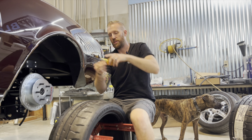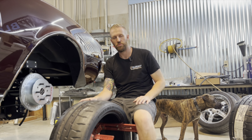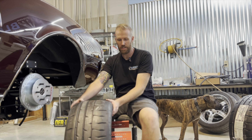Here we have Joe's 68 Firebird on the Roadster Shop spec chassis. The first thing we're going to want to do is measure the wheel well width — about 11 and a half inches — so we're going to order a tire that has a narrower section width than that. This particular car we've been running 275s for years. It's always fit really well, so we decided to go with a 275 again, except this time we're doing an 18 in the front and a 19 in the rear. This is a 275-35-19. It should fit very nicely — it's a Potenza RE71RS tire, a 200 treadwear tire, nice and sticky asymmetrical design, so it's going to make this car handle really well.